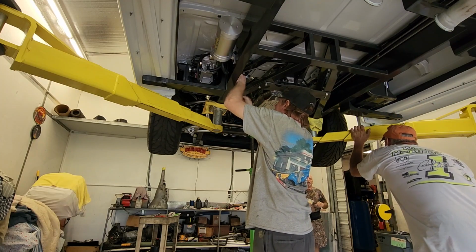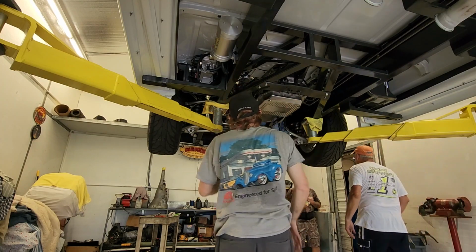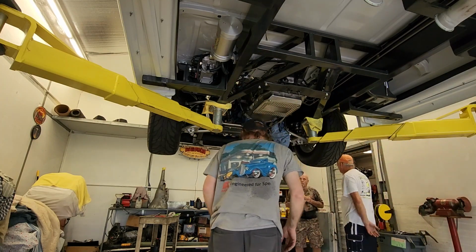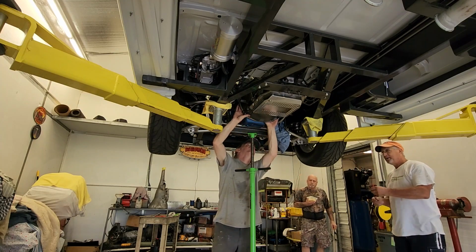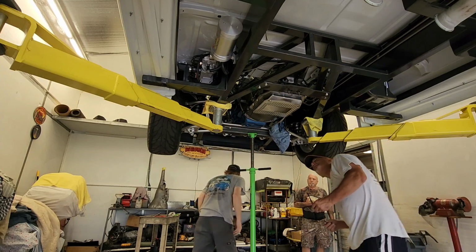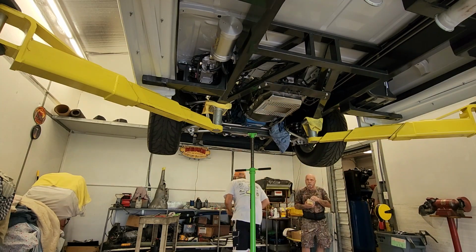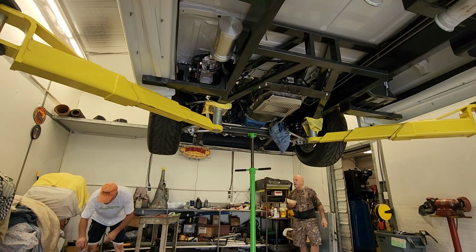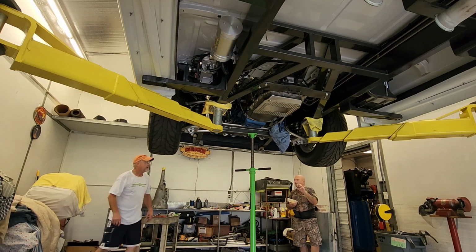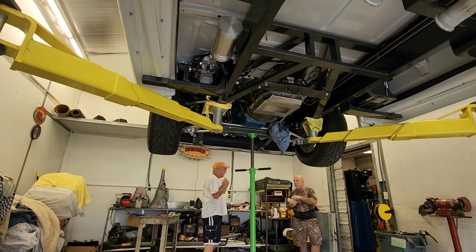I put the whole Ford together with wire ties. Well, they all want these big cams, you know, and then they start shaking everything loose. We've got to get the converter to pop back. And this cam isn't that big. No, it's not. It's a 498 FE or something. It's the same cam I had in my Falcon when I got 15 pounds of vacuum. It says he can only get 12 out of this, so I don't know what to say.